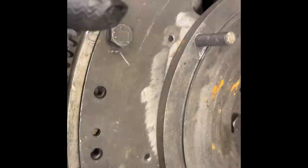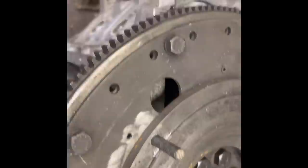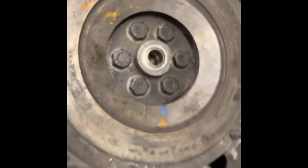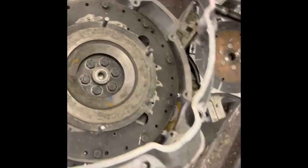I took a flex plate off an automatic and bolted it on the back. These bolts come right through from the back because it's all about overall length - I need the engine to be as short and as close to the gearbox as possible so I can get it all in behind the back panel of a standard car. I've machined the block a little bit with a grinder just to get some clearance. This all does turn, so obviously you'll have to drop the starter motor a little bit to compensate. I've also chopped up a Range Rover bell housing and machined it.